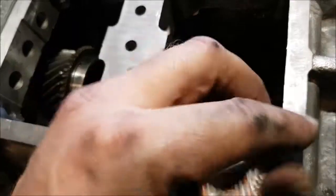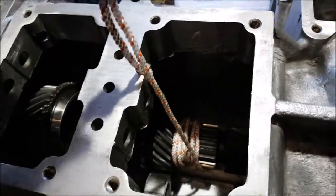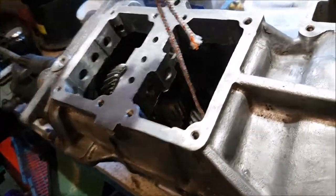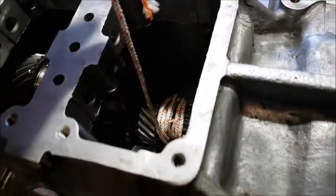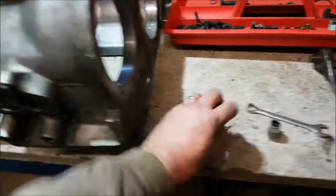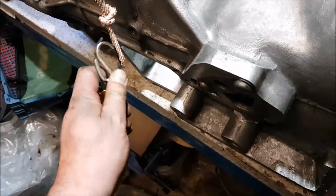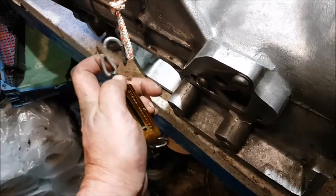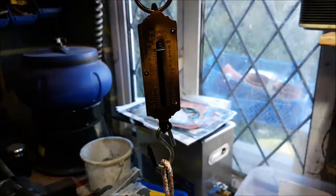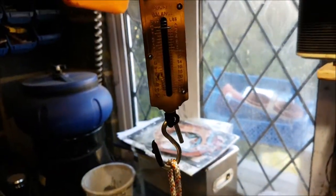So what I'm needing to do here now is to measure the lay shaft preload. It's on coned bearings. I'll show it as you withdraw this string which I've wrapped around the shaft — it should have a certain load, and the manual says 2.75 to 3.85 kilos. And when I attach my trusty spring balance one-handed onto the string and start to lift, we've barely got half a kilo.